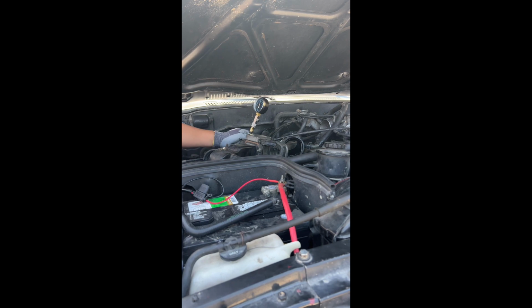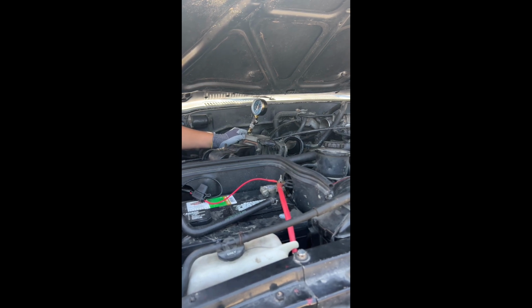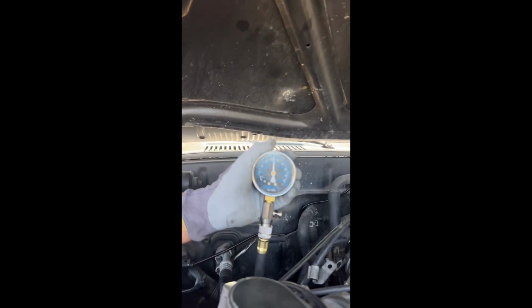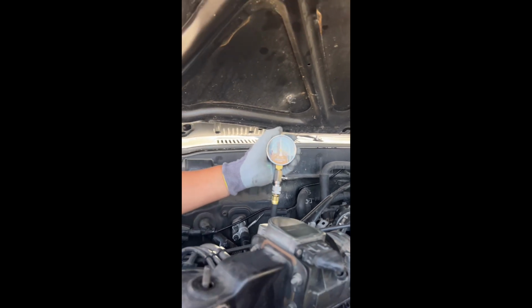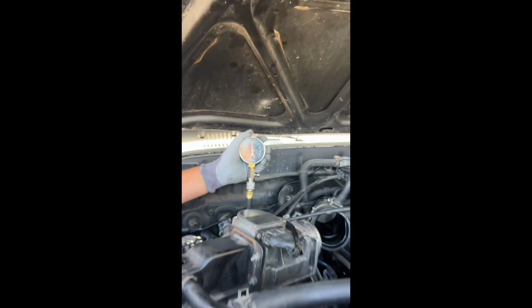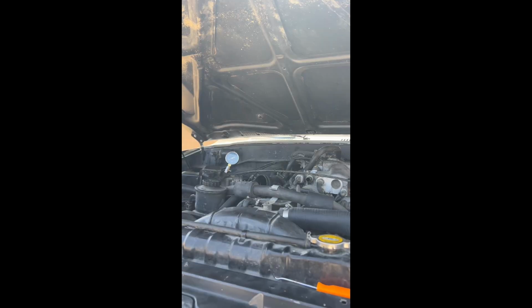That was better. How are we looking? Like 150. 150. Flat. Flat. Nice. Is it going down? Oh, that's good. Solid right there. Okay. Third cylinder we try so far. 150. Can't complain. That's pretty solid. Still three to go though. 145, about. Still pretty solid.